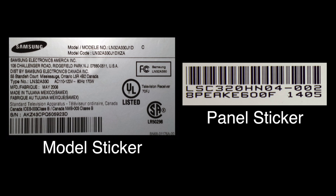Although a manufacturer may produce thousands of TVs for one specific model number, the panel and internal parts can vary from TV to TV. Brand and model information can guide you to replacement parts but cannot guarantee compatibility. This is why it is so important to always match part numbers on your original boards and parts with the replacements that you are buying.